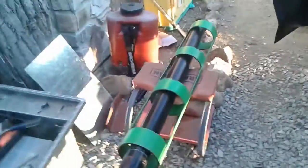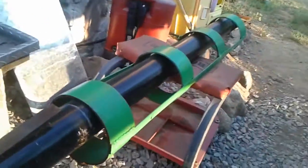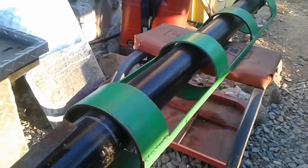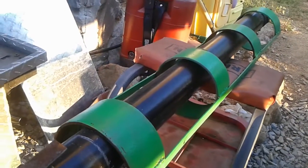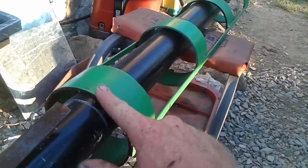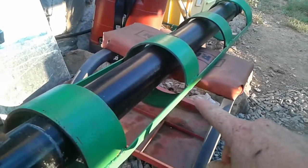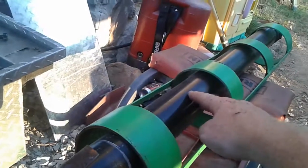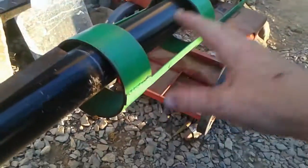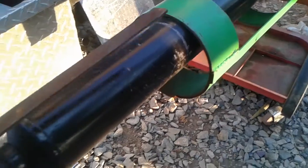And you can see down here, you have to excuse my mess. This is my work zone for this truck. Got the driveline collars. This is actually the rear driveline from the truck. It is out of it right now because we need to put the new transmission in it, which is hopefully coming soon. It's all 1/4 inch, everything linked together. This is actually one solid piece, I should say. If the driveline were to split in half or anywhere, it will be retained inside these collars. That's the biggest thing with that.